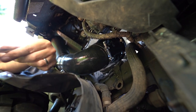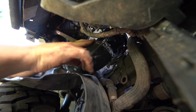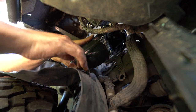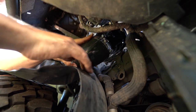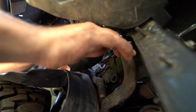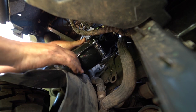Everything uses a 10 millimeter, and then just do a quarter turn at a time, depending on how much space you're working with. Don't want to over tighten it because you will be using a T-clamp on a silicone to plastic coupling device, so you just want to make sure it's nice and snug and to ensure that it's 100% waterproof. Other than that, this is the final step